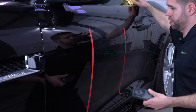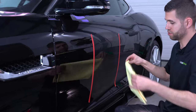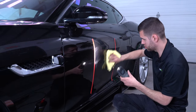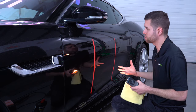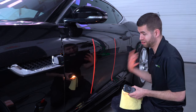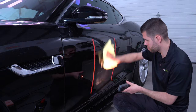Let's bring it in and get our removal cloth — one of my absolute favorites, the Rag Company Edgeless 300. Awesome polish removal cloth. When I was using it, I really liked the work time. I probably did about four crosshatch patterns with pretty heavy pressure and really slow arm movements.